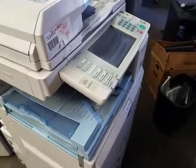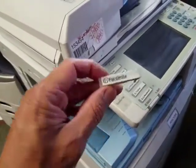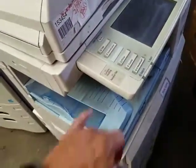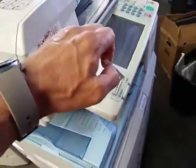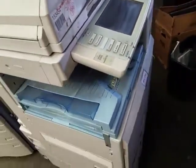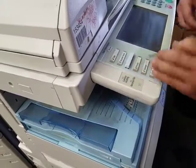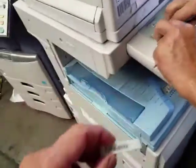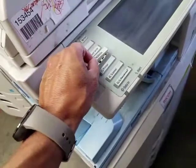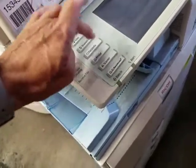Okay, the last thing you need to do is, if your machine does not already have a little button that says facsimile on it, it would have what we call a dummy button, which doesn't really do anything. We have to pop that out. Excuse the look of our machine, it's kind of dirty now, but I'm using this just for demonstration. So it's real simple to pop this out. Just get a real thin flathead screwdriver, and on the edge, gently pop it out, just like that. And again, only if yours does not have the facsimile button. It's got 4 little legs on it, if you can see. You just simply make sure it's straight, of course, and not upside down. Just pop it in there like that and gently push it down, and now your button will work.